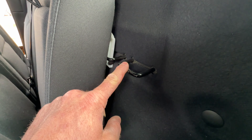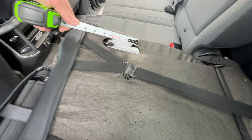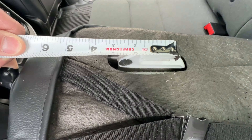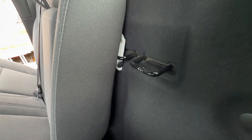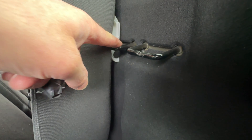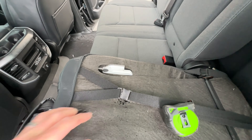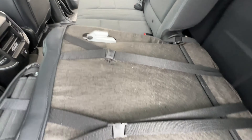You're going to cut yours about right here so that when you lift this up, that white bracket is actually lifted up above this black bracket. When you're at just about that angle, go ahead and pull your seat forward just like I did on this seat. If I take a measuring tape and measure from the bottom of where I cut it off to the top, it's about two and three quarters inches, give or take. Just go ahead and use your judgment — lift that seat up about right there, then take a measurement or use a black marker and mark right at the edge of the white cap. After I cut mine off, as you can see, it's real close to two and three quarters inches.